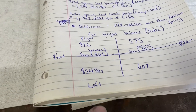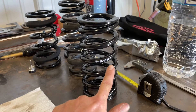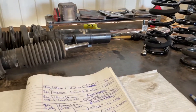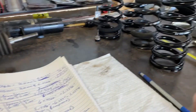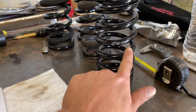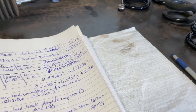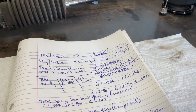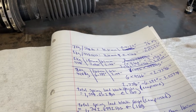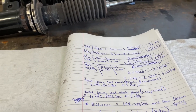The reason I calculated a sum is that manufacturers don't spec out what type of spring goes on each corner, especially from OEM to aftermarket. So you have to work with a sum — like 8k or 448 pounds per inch of spring. There's a lot of play involved with manufacturers and aftermarket companies to get the right ride height, spring height, and spring load for block height.